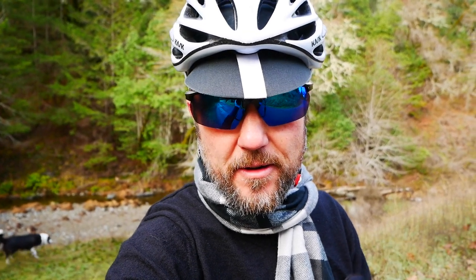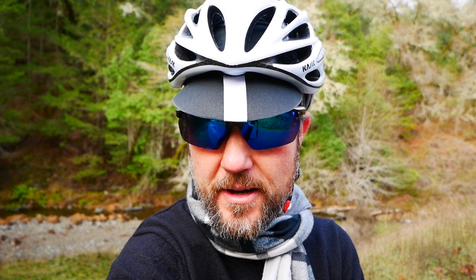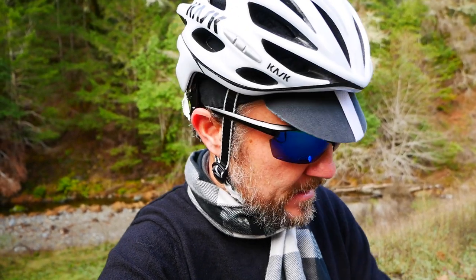I wanted the thinner walled, lighter tire on the front so that it would handle the bumps better. And usually when you're riding, you're about 40-60 weight distribution. So with the thicker wall tire on the back, my theory, totally unscientific, was that that would make more sense. So since that video, let's do a quick rundown of what I think of the Compass tires 3,000 miles in. On the front tire, I have had one flat that I remember.